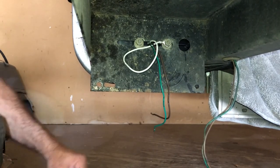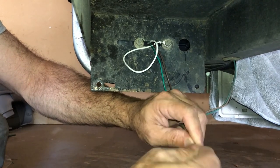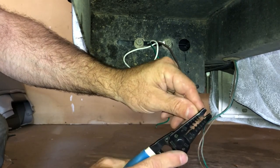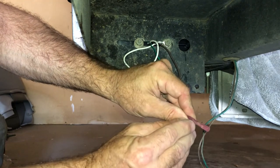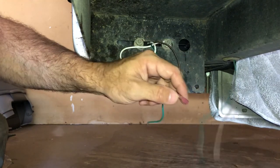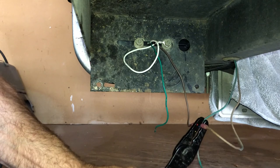The first thing I'm going to do is connect this brown wire. I'm just going to strip a little bit of the rubber off, then twist it up. This one already came stripped a little, so I'll just twist it and trim a little off because I don't need that long a wire. You just stick your wire in there and make sure it goes past that little sleeve, then take a pair of crimpers and squeeze that wire down. Then I'll take the other end, slide it in there, make sure it goes all the way in, and crimp that wire down tight.